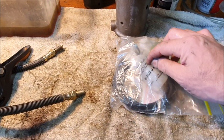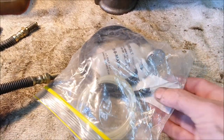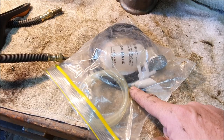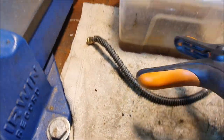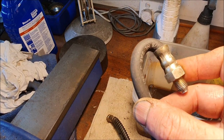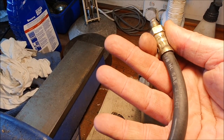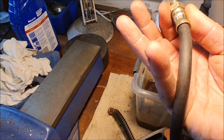You just pump it through until there's no more air in the lines — quite simple. The bleeders are different sizes on the front and rear, so at the rear I could just use the black hose over the bleed nipple. At the front I had to cut a piece of plastic tube, stick the end of the black tube into it, and that would fit over the nipples. I still can't figure out where these hoses are supposedly cracked — even when you bend them over I'm not seeing anything wrong. When I go to get the warrant I'll say they told me these were cracked so I replaced them — can you please show me where the cracks are so I know what to look for next time.